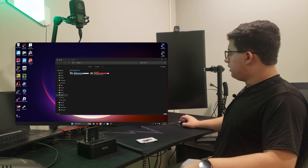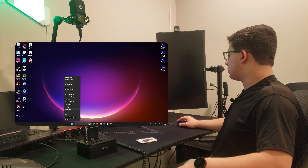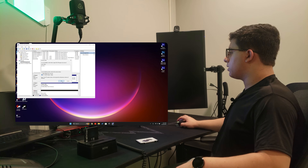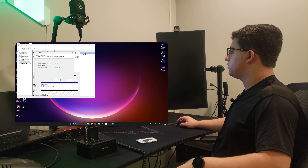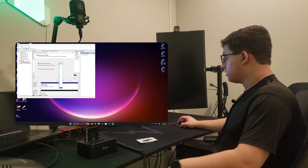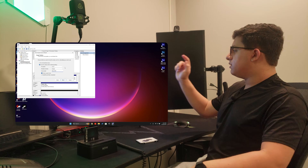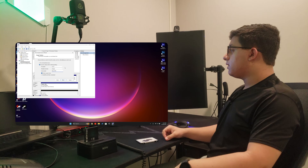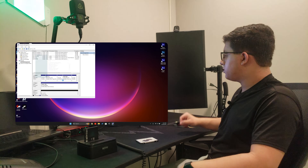Okay, now you can see my computer just to the left of your screen. There's nothing showing in This PC for the drive. So what you have to do is close out of this, right-click Windows, go to Computer Management, go to Disk Management, and click it. You should be prompted with a dialog — just click GPT. Then come to Unallocated down here, click New Simple Volume, next, next, and you can really name this whatever you want. I'm going to name it X for Xbox. You do want to format it — I made it NTFS file format because you want to do that. Xbox will not read it in exFAT, FAT32, or whatever. I named it Xbox SSD — well, why not? Click next, then finish to format — there you go.